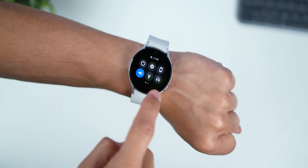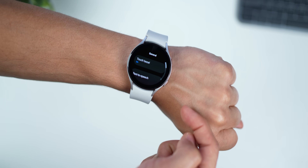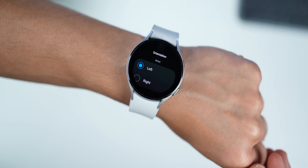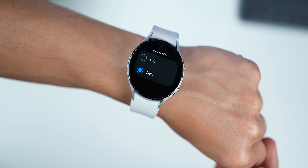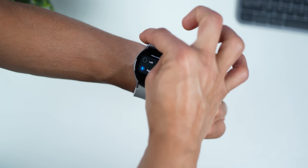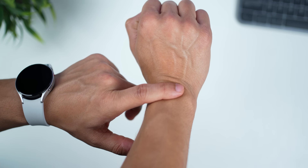Samsung added an accessibility feature for those who prefer wearing their watches on the right hand. If you go into general and then orientation, you'll now be able to decide which wrist you want to wear your watch on, and accordingly change the functions. You can select right or left, and it will also interchange the buttons. To make this work, you interchange the straps, turn the watch around, and place it onto your right hand so the buttons are on the left and the functions are interchanged. It's impressive that Samsung has paid attention to such meticulous detail regarding wrist preference — that's what sets a few products apart from others.